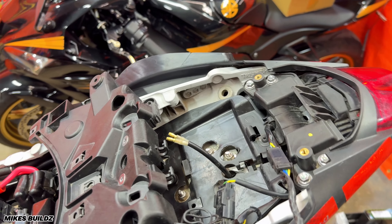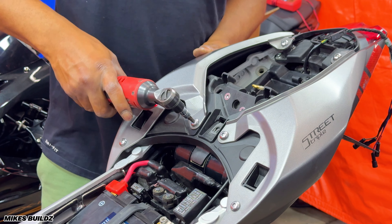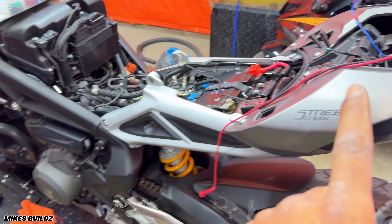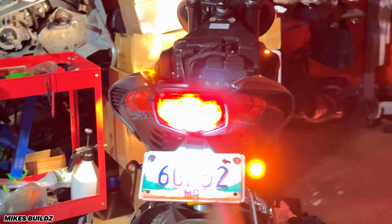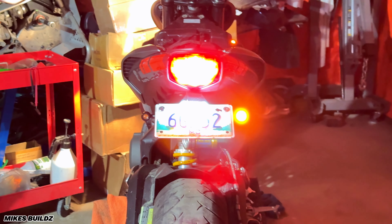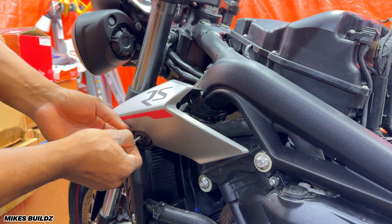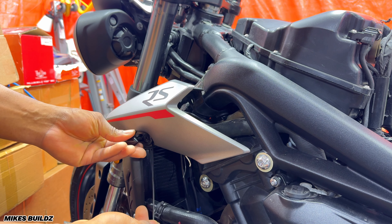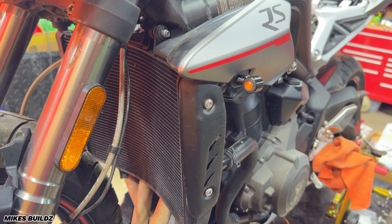As you can see, the grips are in really poor condition — let's change that. So I haven't seen this before: it looks like Triumph wants you to run a proprietary grip. The grip has all this insert over here — these tabs, I guess, lock in here. What I'm going to do is take this off, sand it smooth, and run the Pro Grips I usually use on all my builds, with some super glue. Old-fashioned way. Now with all the tabs removed, we're going to scuff it off a little bit. The next part going on this bike is these beautiful grips from Pro Grips. Super nice — very nice feel to this. Now with the grip glue added, we're ready to toss this on both sides.